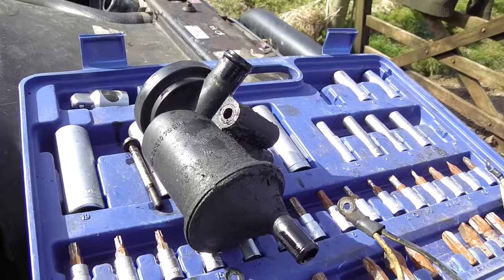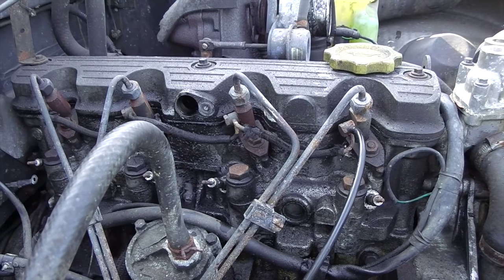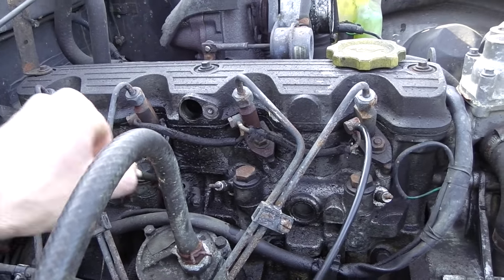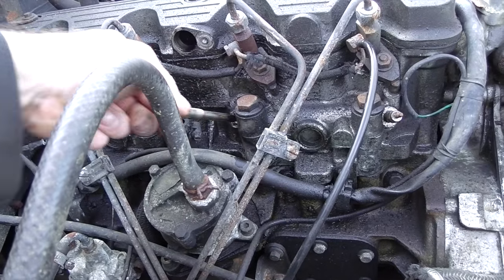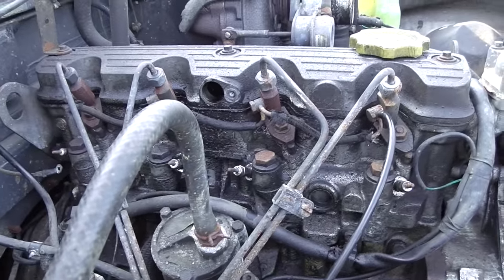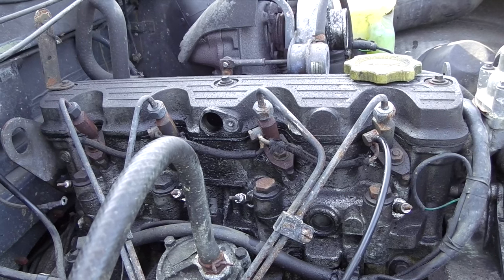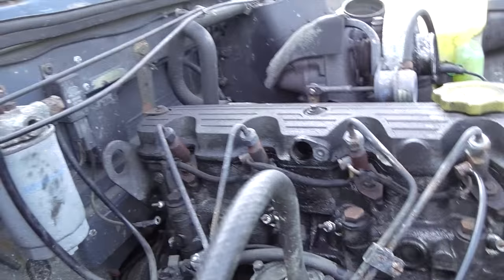I found the breather was blocked, so I've got a nice new breather to go on. She is on startup sometimes a little bit lumpy for the first five or six seconds, so we'll change the glow plugs. I thought I'd do this with a really stone-cold engine — she hasn't been started for about a week. Number one glow plug is pretty good, but this one is quite badly oil-soaked and this one here is also quite badly contaminated. That can indicate multiple possible causes, but one of the most common on a high-mileage 200 TDI is the valve stem seal, allowing oil to run down past the seal, down inside around the valve and into the combustion chamber — which gives you blue smoke on startup and contamination on the glow plugs.